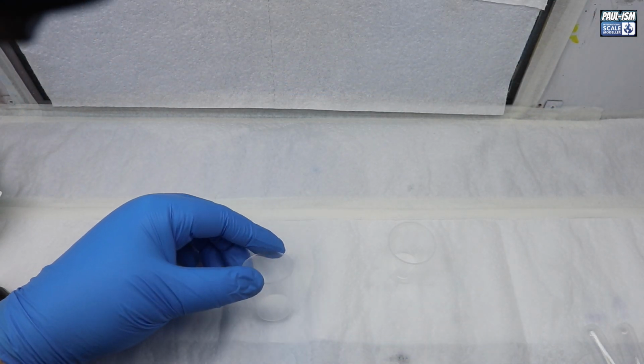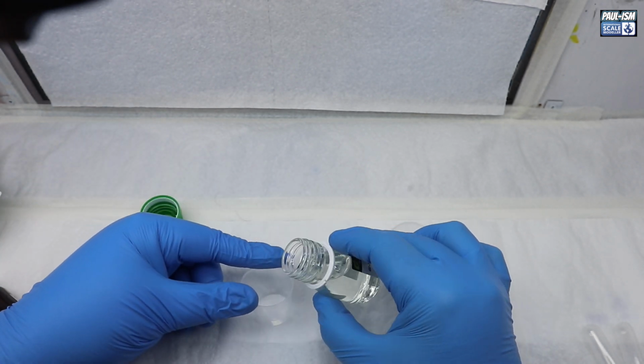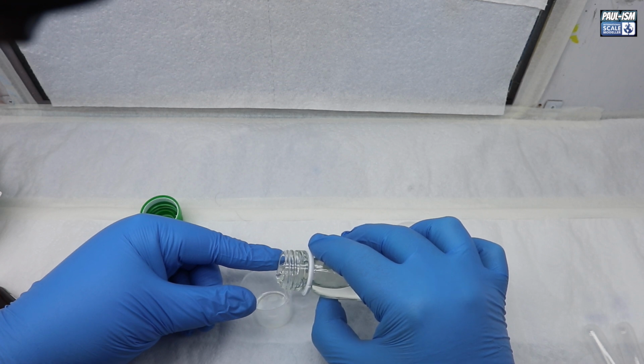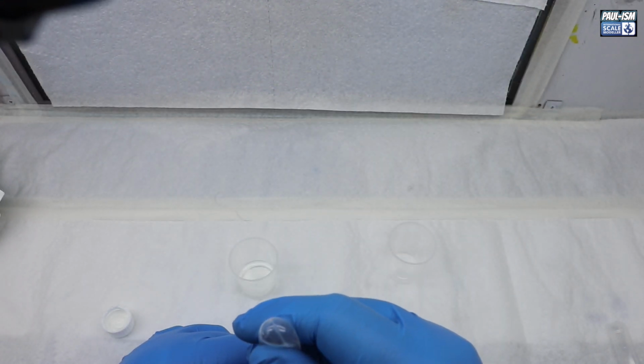Now, the spray booth. We've changed some stuff in here today. I'm going to talk about it in a second when I'm putting the tack coat down. But first off, we're going to mix 6ml of clear to 2ml of hardener and then 2ml of thinner. So that's our 3:1:1 mix. We're going to use this mix entirely, so just about getting enough to do this body.